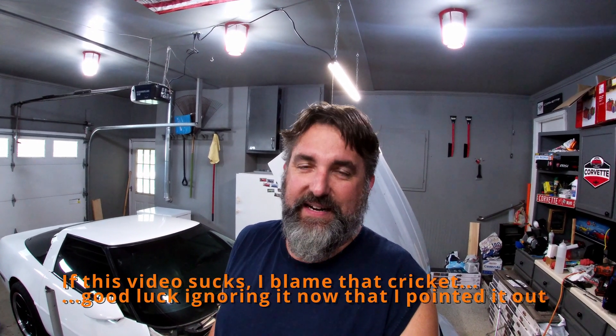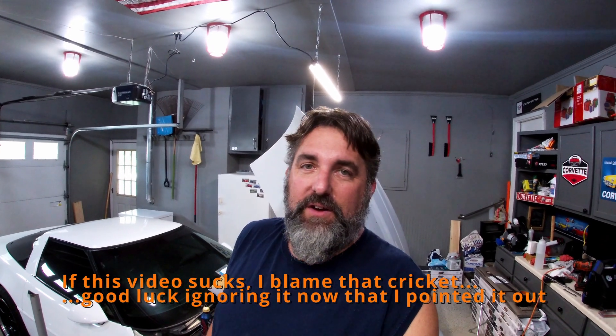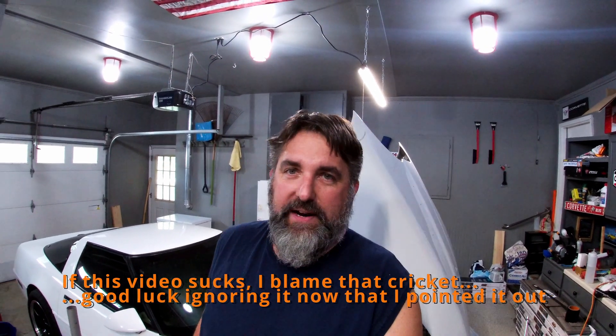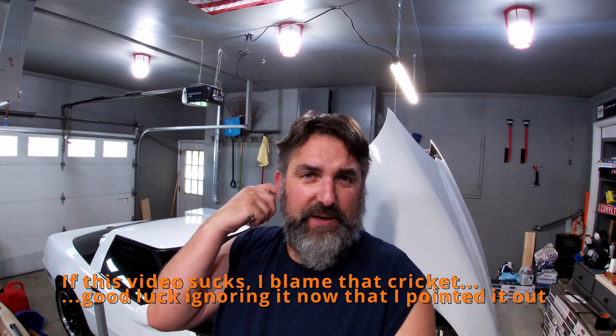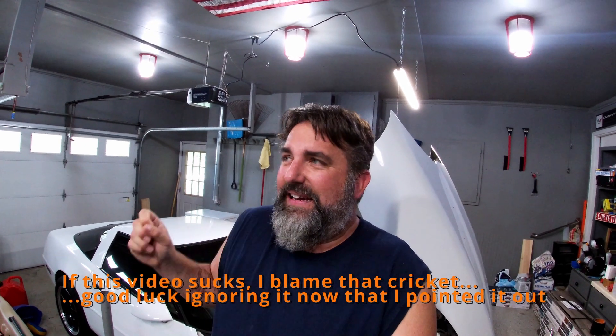About a year and a half ago I swapped out the distributor — the Opti-Spark — for an aftermarket one that made it more of a newer style, so it's vented versus the 1994 which is a sealed unit. I think maybe that unit is just bad. I'm kind of out of options as to what else could be wrong aside from something drastic like blown head gaskets, so we're going to swap the Opti-Spark for a factory replacement unit, get rid of the vacuum lines, and see if we can get the car to run normally.